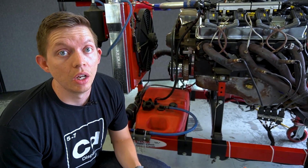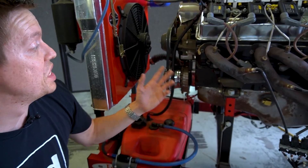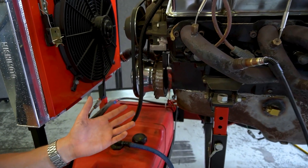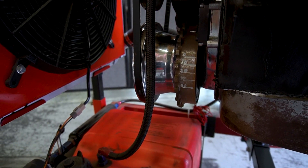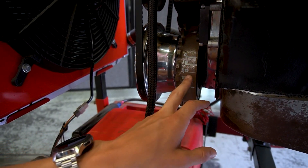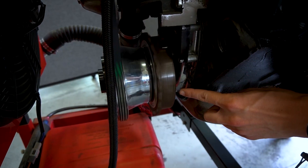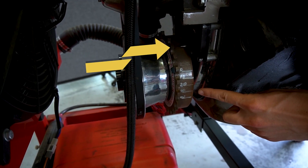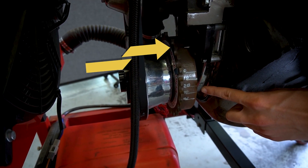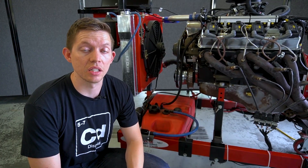On the crank pulley, depending on your setup, there will be a number of different timing marks — it could be a factory timing mark at 15 degrees. On this timing pulley we didn't have any factory marks, so we had to make our own. Using a paint pen and a degree wheel we set our marks at 0, 10, 20, 30, and 40 degrees. The goal here will be to get that line and number to line up with our pointer on the block to match what's in the InfinityTuner software. Let's get our timing light, clamp onto coil number one, and start making some adjustments.